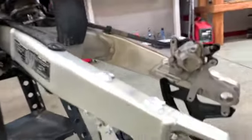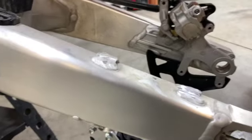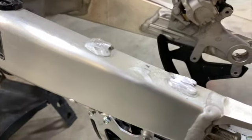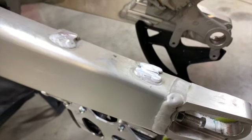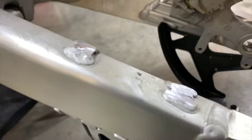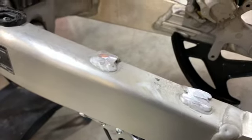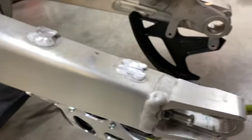Got the tabs cut off, still going to have to grind them down here. I did actually take the chain off — I didn't think about it at the time, but I was getting a lot of aluminum material on the chain, so I took it off and cleaned all that off so it doesn't harm the chain or the O-rings. So I'll go ahead and keep grinding these down a little bit and then start sanding.